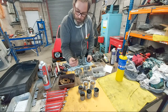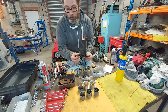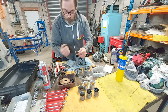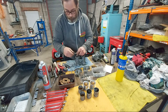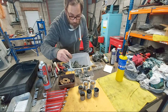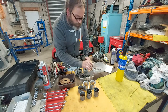Now this needs Gavcon phosphate coat. This chemical black it again. Because I hit it with a copper hammer on the sides, it's very possible that it doesn't even need its threads cleaning. That's a good thing about having one of these handy, guys, because the copper gives way before any steel. So that needs chemical blacking. We can do that in house. These things here will need bead blasting, then rinsed in possibly brake cleaner, dried and then Gavcon zinc plate.